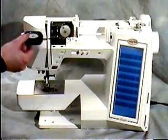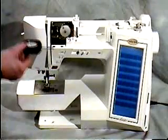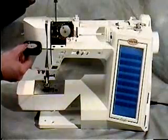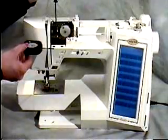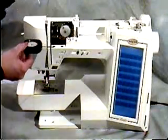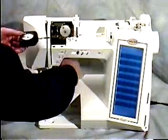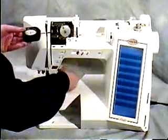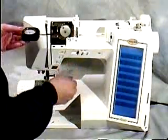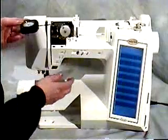You should have a tension reading of 11 to 14 grams. If not, adjust the brass Phillips screw clockwise to increase, counterclockwise to decrease the gram pull. This will be a very sensitive adjustment. Raise and lower the presser foot several times, rechecking the gram pull. Once this is achieved, raise the presser foot and retract the thread.